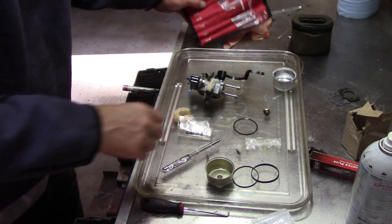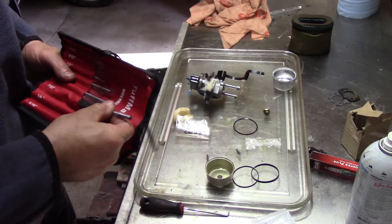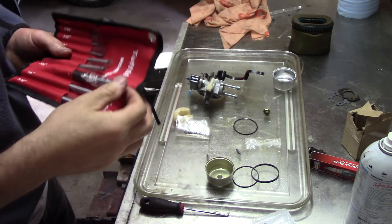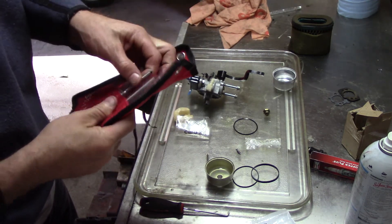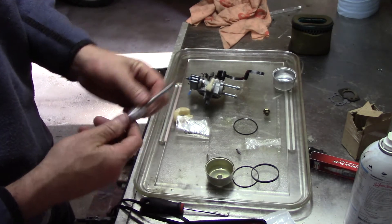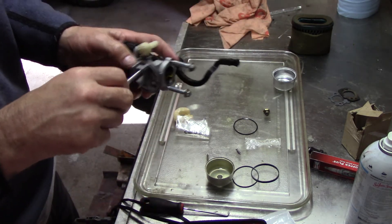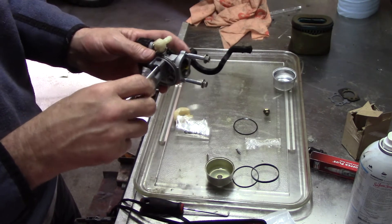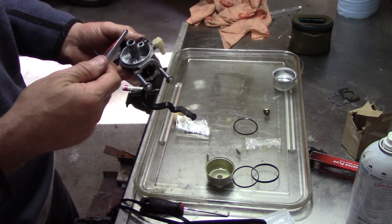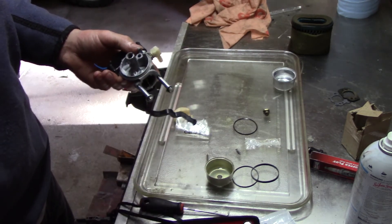My battery died anyway — what a roll pin is — I bought this a while back, probably two or three years ago. Because I needed to bang on a roll pin and used a screwdriver, you know, a little thin Phillips — bang on a roll pin. That makes a mess out of things, screws your screwdriver up. So I got some roll pin punches. I keep using this 7/32nds roll pin punch because it fits into the carburetor seat with no play — that's what I use to push the seat in. You'll feel it seat. It's a really tight fit. I wouldn't recommend using a Phillips screwdriver. See how it's got a blunt tip for a roll pin? Works great.